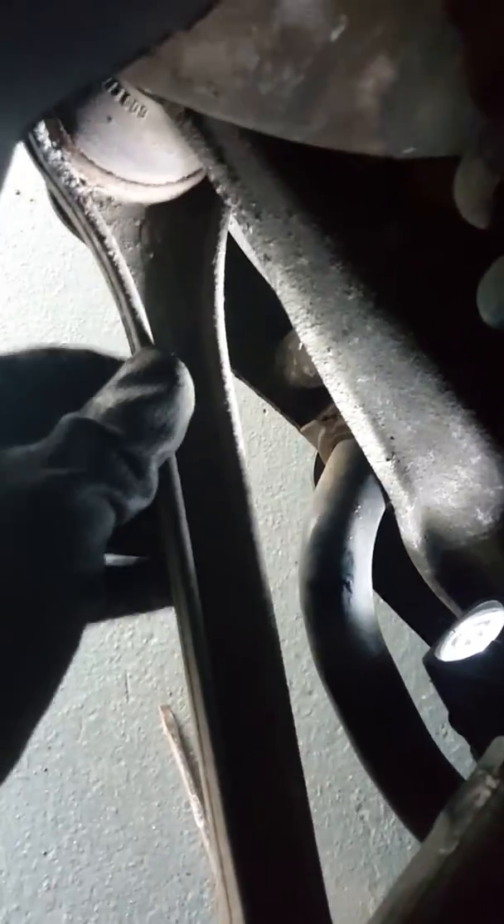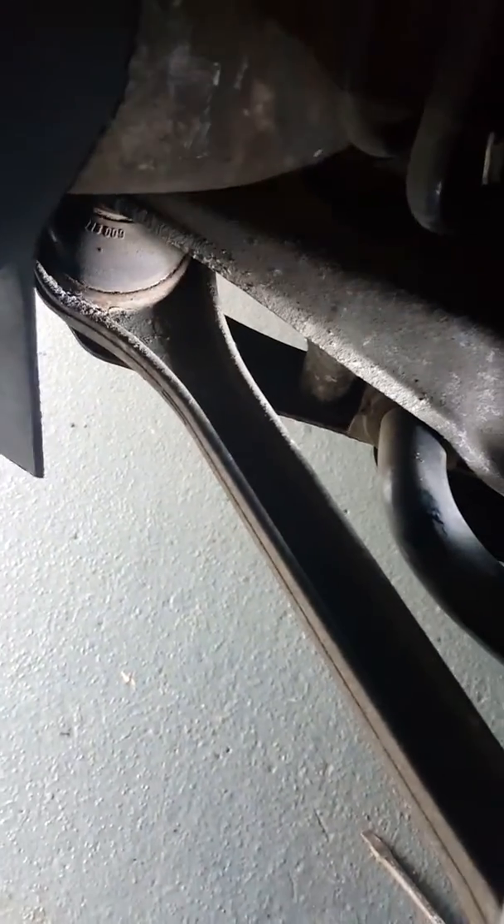This particular Boxster has a worn tuning fork. If I get hold of it, I'll show you what you need to be looking for. Can you hear that? That ball joint has got a tiny amount of up and down play, and that will make a very annoying rattling noise when you're driving along small bumps. So we're going to change that and get rid of that noise.